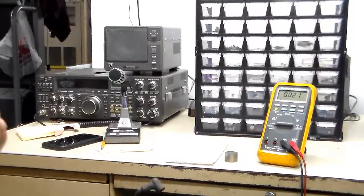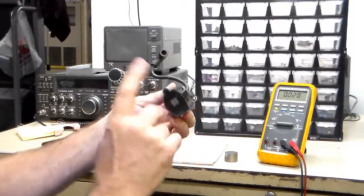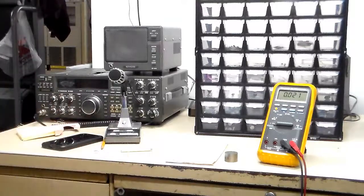What I was going to do was check it real quick and show you what I've come up with. Coils are pretty interesting things — basically they're two coils. In this instance, since it has a magneto — a magnet in the flywheel — it has one coil, and the other coil is attached to this iron which acts as the pickup. On your car they may have two coils, and in the old days one coil was attached to a set of points that would open and close. Every time the points closed they charged the coil, and every time they opened they discharged it rapidly, and when you discharge the coil rapidly it transfers over into a rapid discharge of the secondary coil, which is at the spark plugs — that's what makes the big spark.